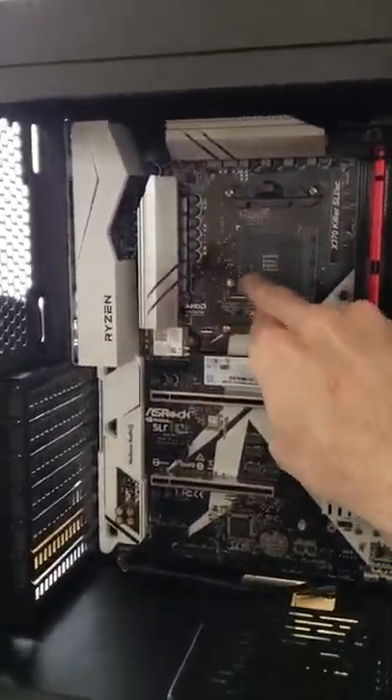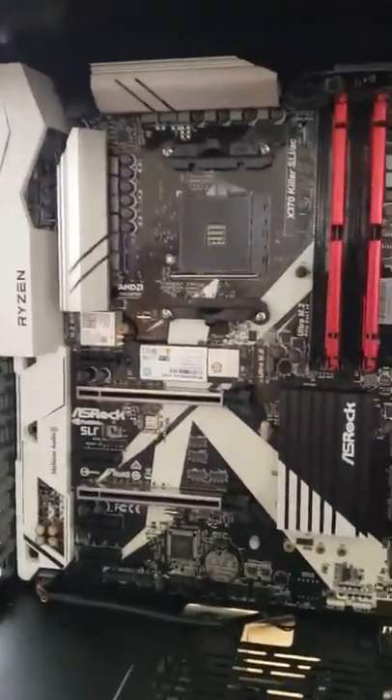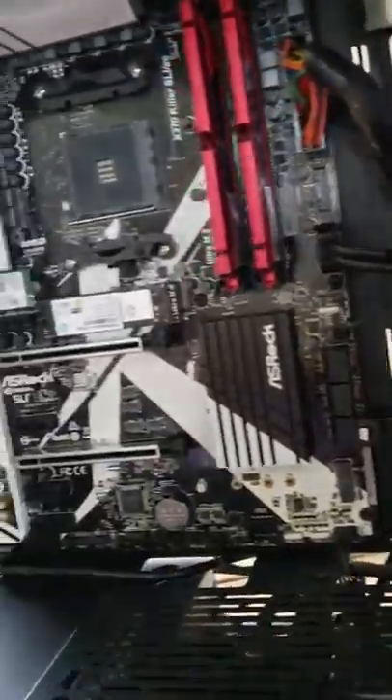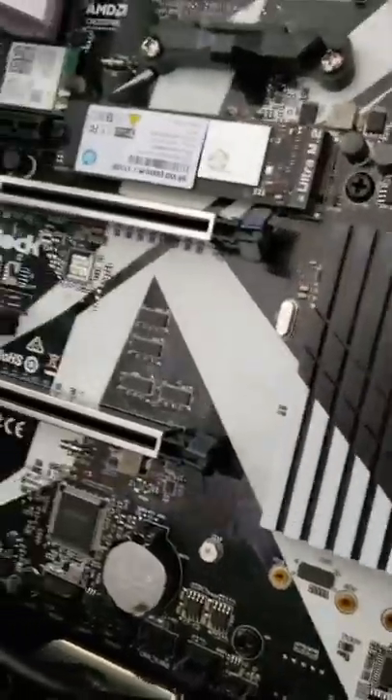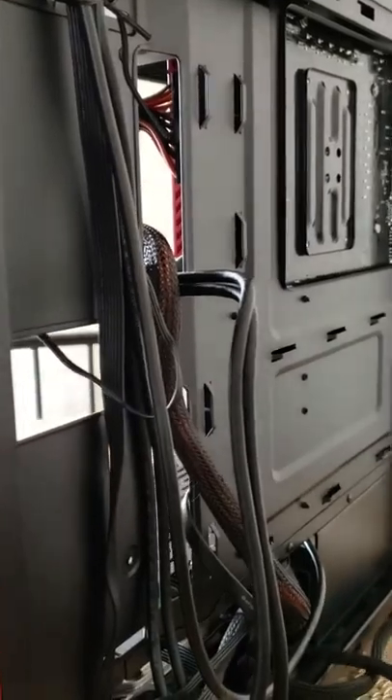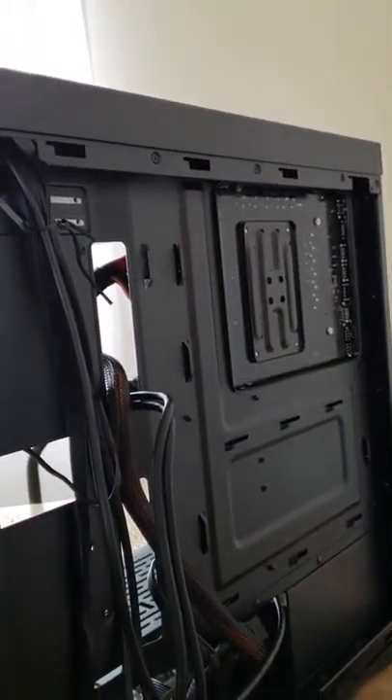There's going to be this cable right down here and two cables hanging off right here for your water cooler — that's it, everything else is just going to be clean and flush. Your side panel is acrylic, not glass, and it's got a film on it so that's why it looks fuzzy, but you'll actually be able to see in there. We'll be able to sync all those lights and everything up. On the back here it's got a panel that comes off so we can do cable management. I've got zip ties right here so all these cables are going to be nice and tucked and neat.